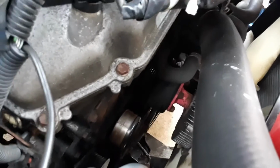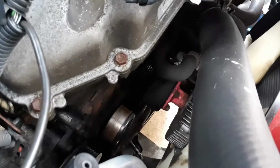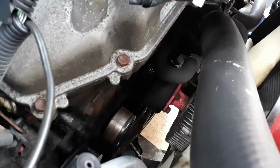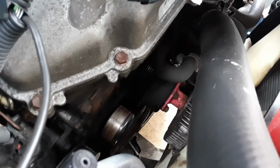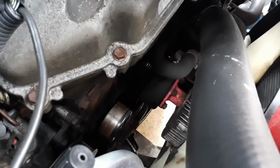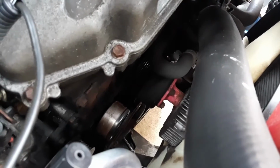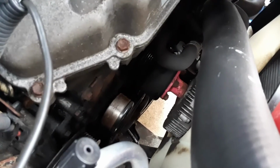If you've got an idler, as long as you've got time, if you can't figure out the size before taking it off, take it off, knock the bearing out, see what size bearing it is, get online, do some research, and find you just the bearing. And if you can replace just the bearing, a lot of times that's going to be a lot cheaper, and you know, it's going to work just as good. And if you get a pack of bearings, you'll have bearings for future use.